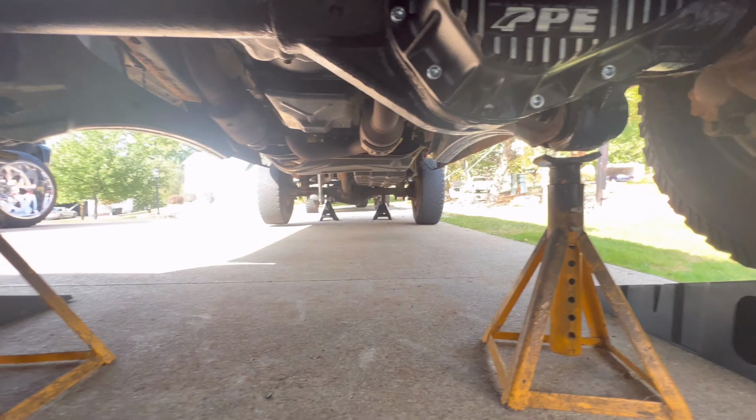See that cover? Well, the mating surface is nice and clean. So we filmed that, got it all cleaned, got it brake cleaned, wiped down. She is ready to have a new PPE cover on it. So I'm gonna take you guys to the toolbox, do a time lapse, add some silicone, and we're gonna come on over here. The Allen bolt for this is a 7/32. The front one was a 5/16. So just keep that in mind, and we'll show you everything getting going.